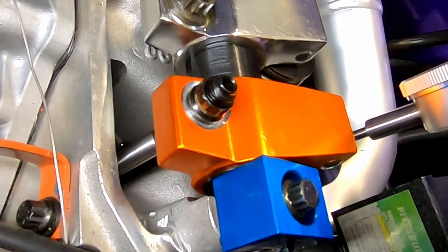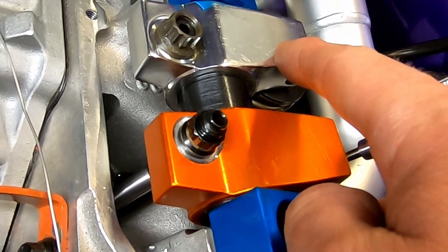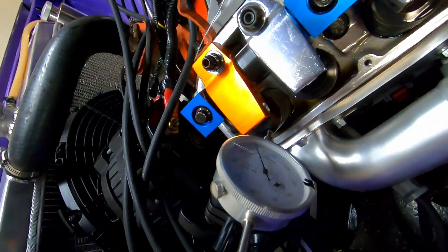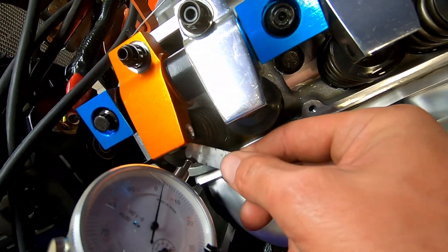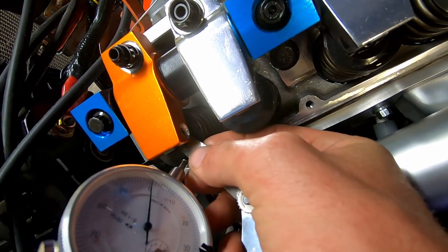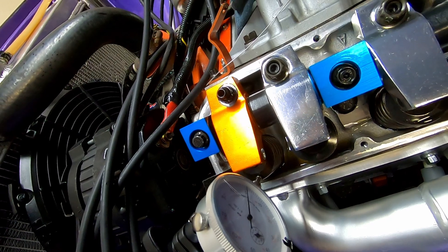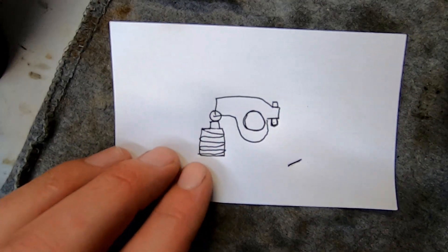Hopefully you saw the other video — I did a comparison between the rocker ratio of a Harlan Sharp 1.6 rocker and a 440 Source 1.6 rocker at the valve stem on this exhaust valve. I've been using it all day with my dial indicator set up and I haven't had to move the dial indicator because I could sneak my two thousandths feeler gauge in just like that. It's very hard to do a two thousandths feeler. Typically I just go zero lash and lash them, then check them later after they're heated up to temperature. But before this engine runs again, all the Harlan Sharps are going on with the correct pushrod in.